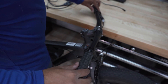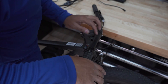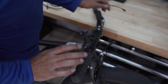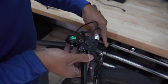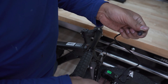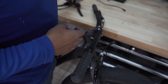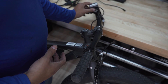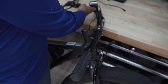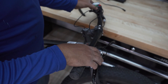The first step is to take off your grips and loosen them off. Then you unplug the wire. The new brake levers have the mechanical brake connection plus the motor cut-off, which you want because it's a powerful motor. My plan: shifter on one side, thumb throttle on the other side, boost control right next to it, and then the brake levers. So let me start by taking the grips off.